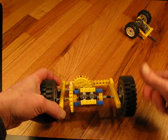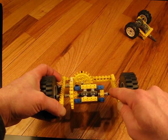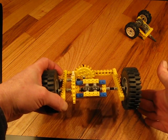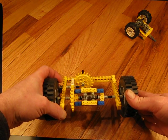As I turn this wheel, you can see the pinion gears start to move. This worm turns this pinion, this pinion turns this pinion. This pinion cannot turn this worm, because a pinion can't turn a worm. That is the fundamental way that a Torsen differential works.